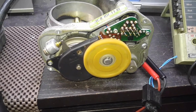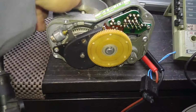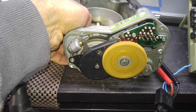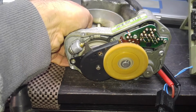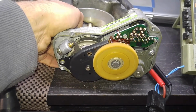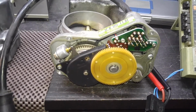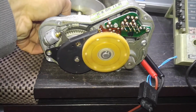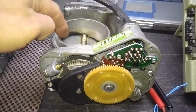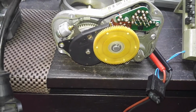The motor is turning. It tries to activate the plate to go to a certain angle, but eventually it will kind of, see, this is your noise. This is the screeching sound that was described when the unit is energized, when the car is started, because the coil is not holding it. Although, because there was so much carbon around it, it sort of stays on idle. It's just a very bizarre situation that this can actually happen, but it did happen.